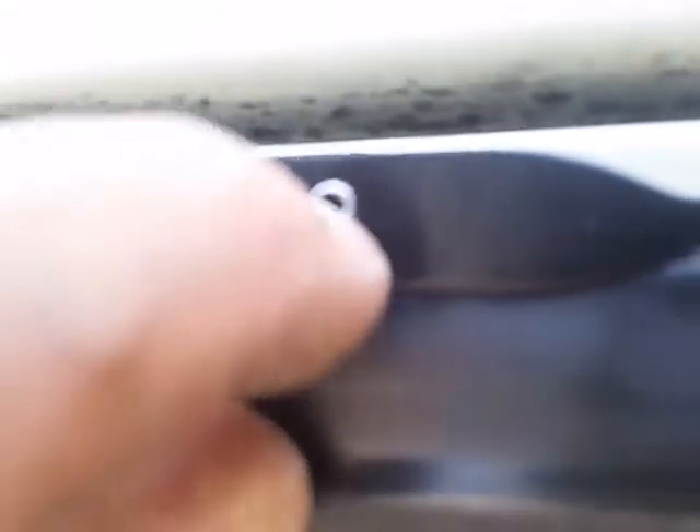The wiper comes with a rivet that you drill out. Use a regular drill bit or a tapered drill bit — anything will work. You see there's a rivet; you just want to gently drill that out. You don't want to make the hole any bigger, because the hole on the other side is bigger when you push the rivet out.